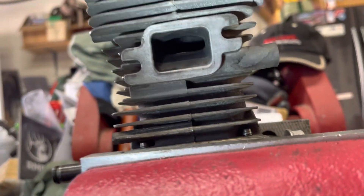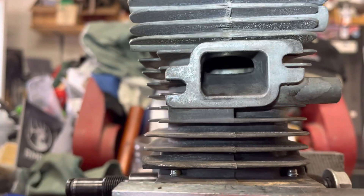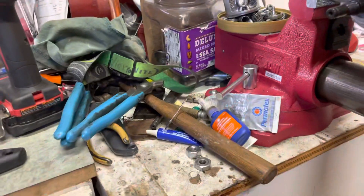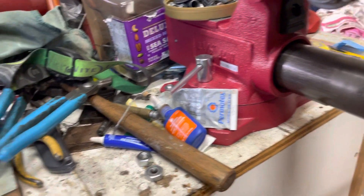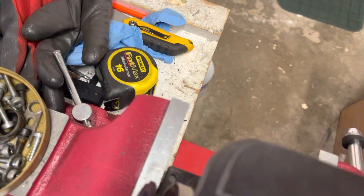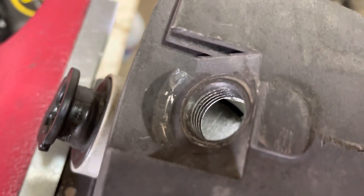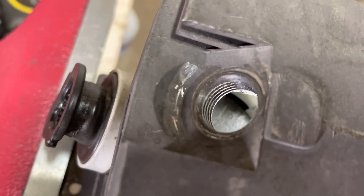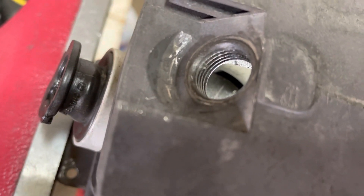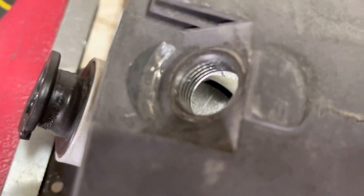Let's get a light on for you here, see what I see in there. It's rather tiny, but it's a tiny little thing. Maybe opening it up just a shade would work. Looking in there through the transfer holes, looking down and through the spark plug. You can kind of see in there — those transfers, there's a hell of a lip. It's like there's a good quarter to a third that the piston blocks off, so it never gets a full shot in there on those transfers.